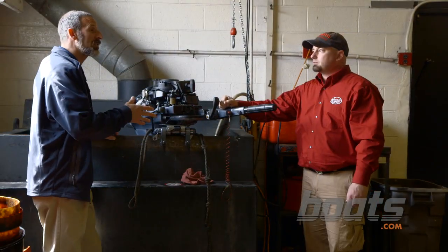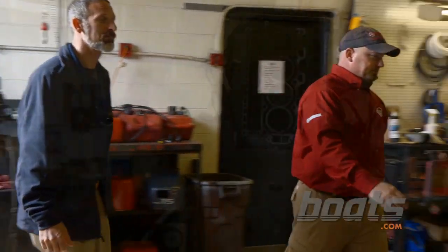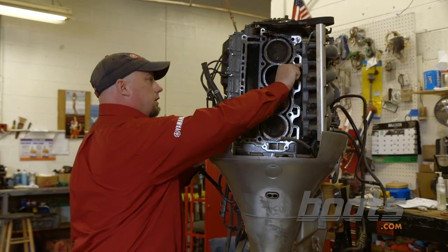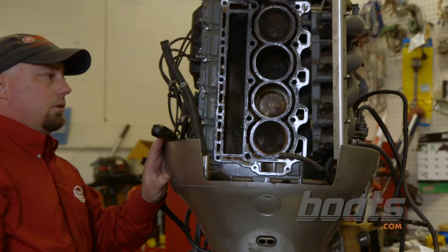So Chris, what's another common problem that you see all the time around here? Well, customers not flushing their motors. Why don't you come over here and take a look at this? Okay, when you come over here, you get a lot of salt buildup, your anodes start to go away, everything starts scaling, and this is basically what you end up with.